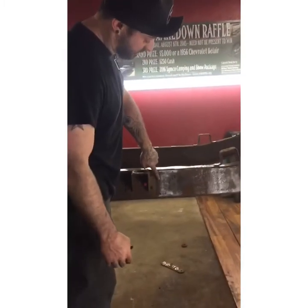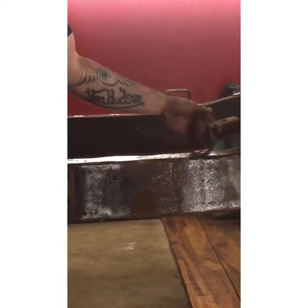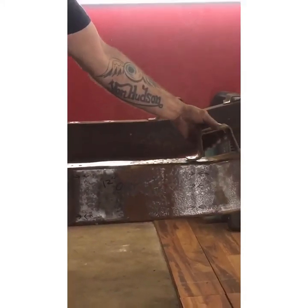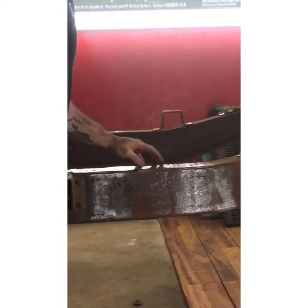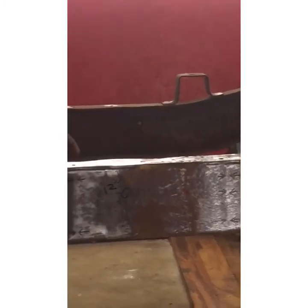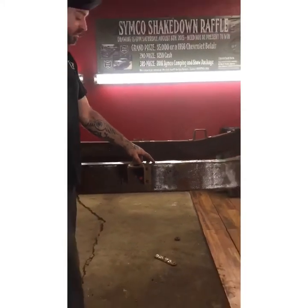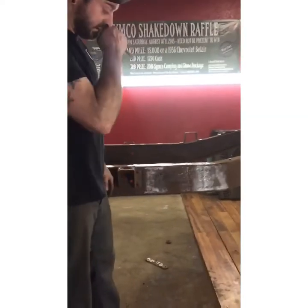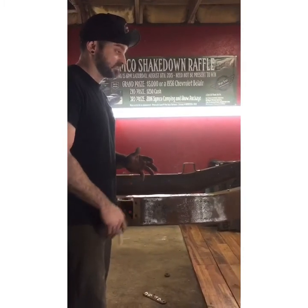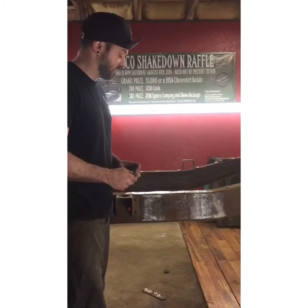You look right around here — I have some scribe marks. There's a 12-inch section right here that's straight, and that's where I'm going to cut out. One of the things that you have to do is take the middle crossmember that's right behind the backside of the cab, and then take this mount off of the bed. Where you'll end up cutting is right behind the hole that is meant for the bed mount, and right through the middle of the first hole that is behind the cab mount — so you have a whole section of 12 inches. I'll show you how I brace it up to make it a little extra strong in a later video, since it's something I don't necessarily recommend for an amateur, but a lot of people do it anyway.